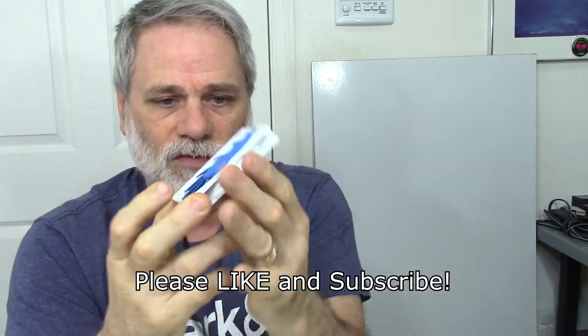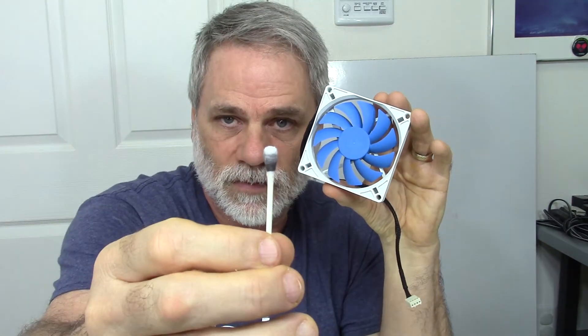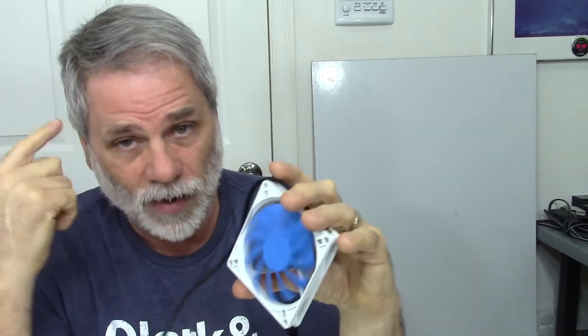It sits in the computer not sideways or weighted — it's just resting on itself and making no noise. But it was making a lot of noise inside the computer. Yesterday when I took it apart and cleaned it up, I used cotton swabs and cleaned all the fan blades and the casing using regular rubbing alcohol — not the drinking kind. But I also used grease, figuring grease would hold up longer to more spinning. That was probably a bad thought, because after a few hours the fan started making noise again.